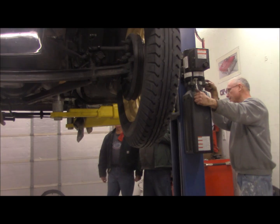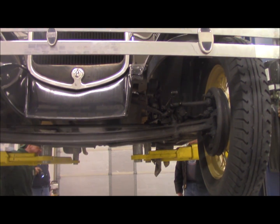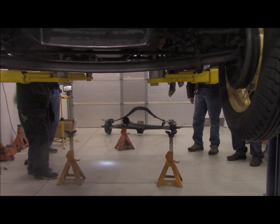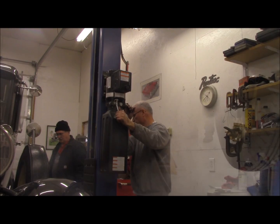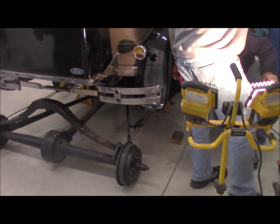Okay. Bring the jack stands up. It's gotta be forward of that. Way forward of that arm. He's coming down. You swing the arm out. We'll stab the rear end in. The wishbone will fit up in there, about where this one is. You're going to have to put it on jack stands. Yes. We've got another 8 inches to go down. This may be easier to lift.